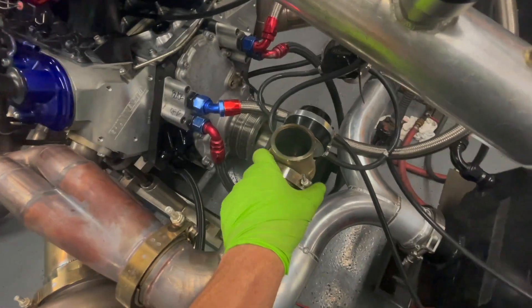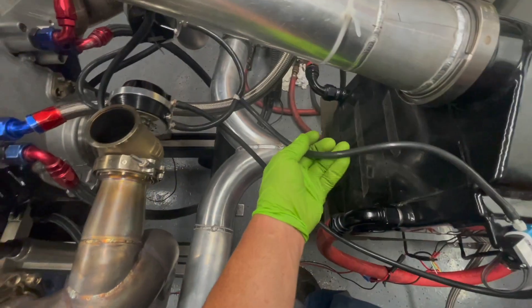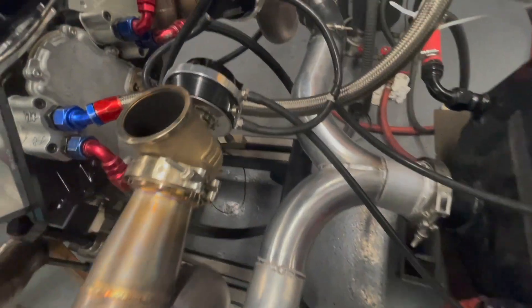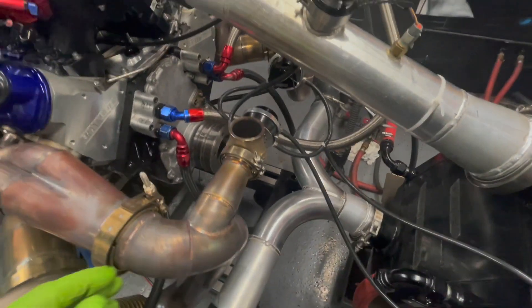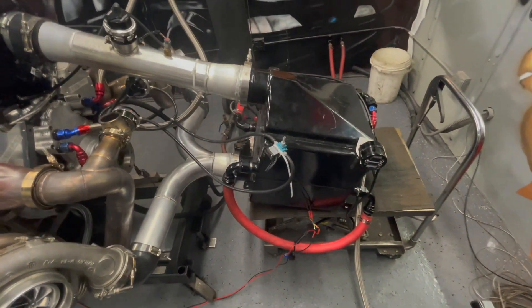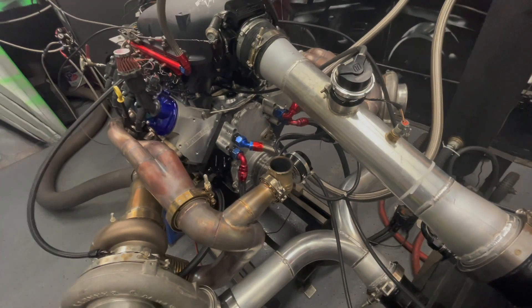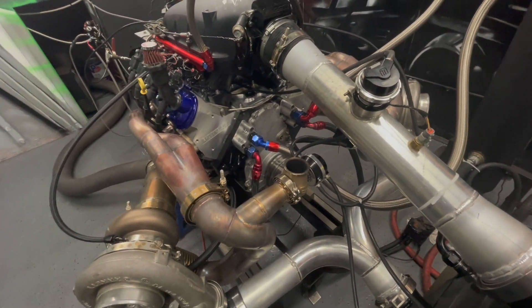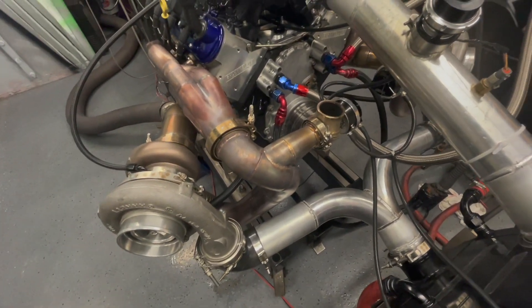That one is discolored, that one is not - and so Diego was right on the money. I was adamant I was right, like no, we've got the bottom ports going here. But then I looked up the actual instructions and realized that is a water port, not another convenient boost port. So everything is perfectly operational now, the boost controller works. We have no boost creep at all off the wastegate - it makes about eleven and a half pounds of boost, good for well over eleven hundred horsepower, and now we can turn the boost up.